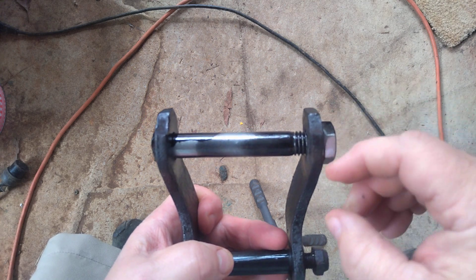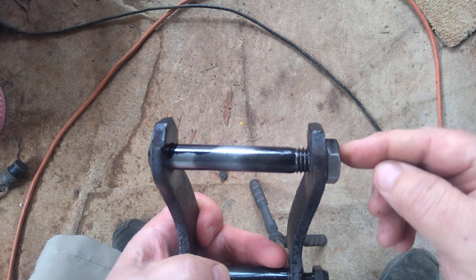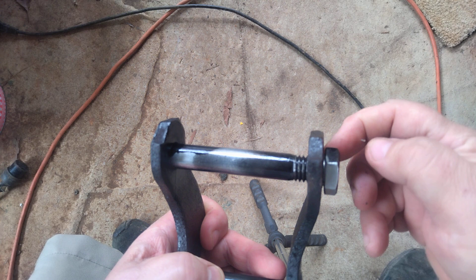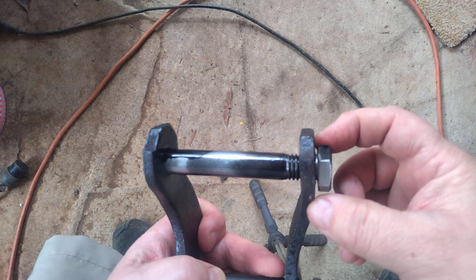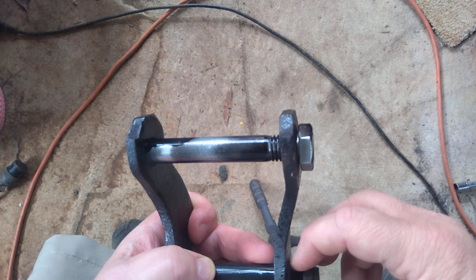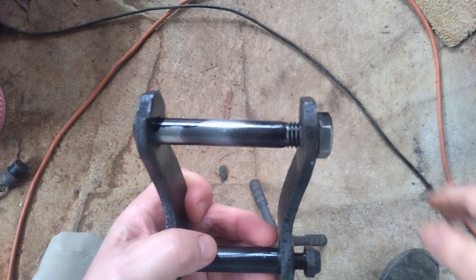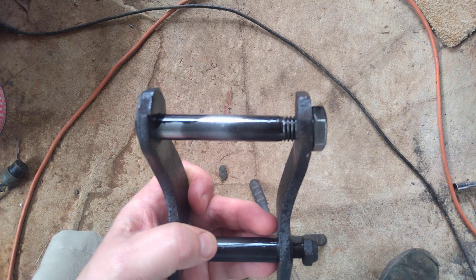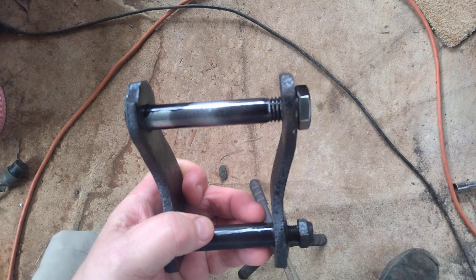It's supposed to be a specific distance, so I tightened it, put the old stud in, tightened it to where it's supposed to be, put this nut on and cut it off. I did have to drill this hole out to five-eighths because it was almost like nine-sixteenths on the lower one. That's how I repaired this — it should be fine.